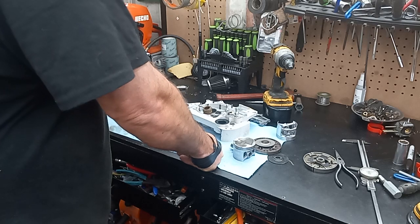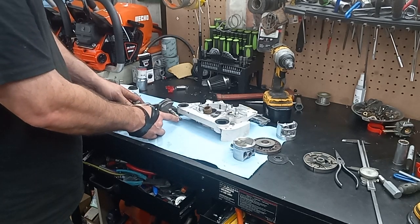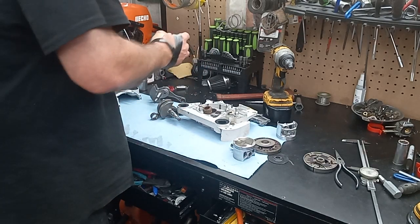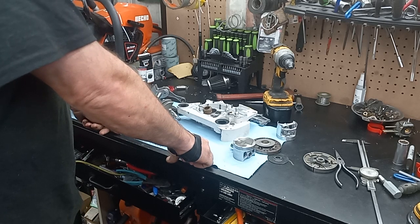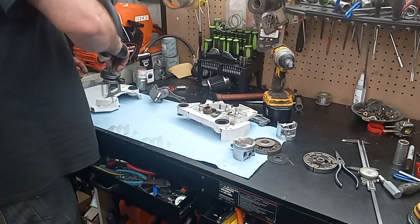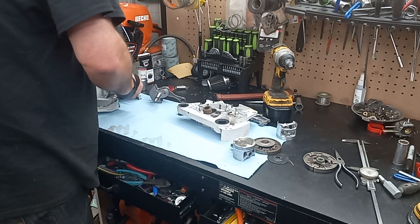As far as overall lengths on this side, the distance on these is about one snap ring's worth. So I'll have to cross that bridge when I get there, but I'm thinking there'll be enough float in the spur gear to compensate for that. Plus side, there will be no machine work other than whatever I got to do to get the oil pump to clear in here with flying colors.